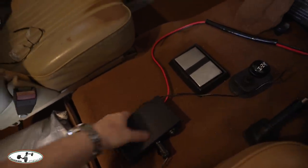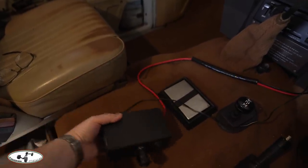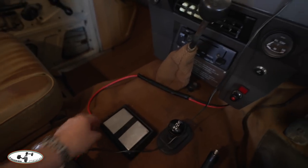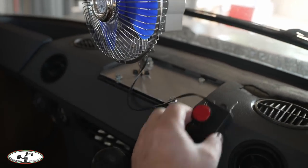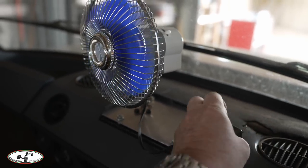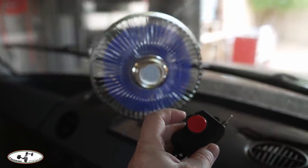So what I did is I ran the breakout box that I actually used on my Trans-Australia trip. I will add a USB charger to that. I ran a new cable from the battery — fused it at the battery — and ta-da, I mounted that. I admit, it looks ridiculous. But it'll do the job. And then I don't have to rip out the dashboard and put in the new one. So there you go. This car is getting cooler and cooler — not cool as in cool. It's not getting cool at all.